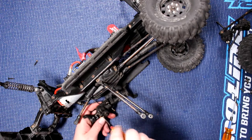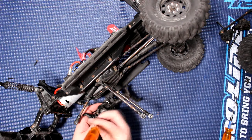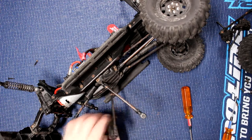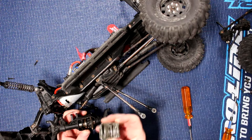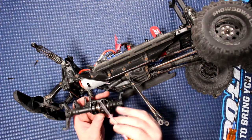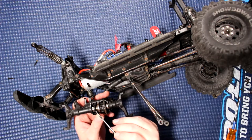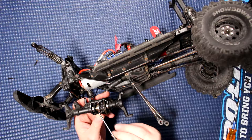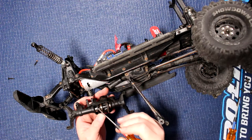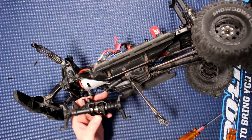These screws here are extremely long. Remove the cap. Now basically the cable is attached to this lever here, and unfortunately we will need to remove this to be able to remove bearings one, two, and three. Just remember how the clip is positioned from the cable to it, because you need to put it back the way it was.